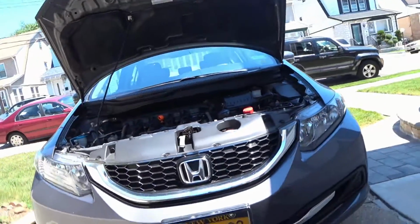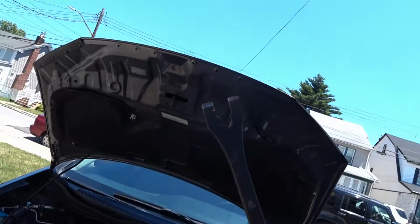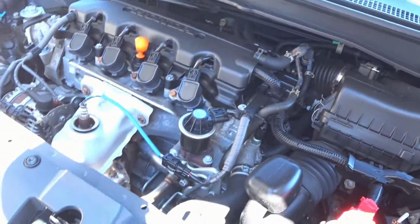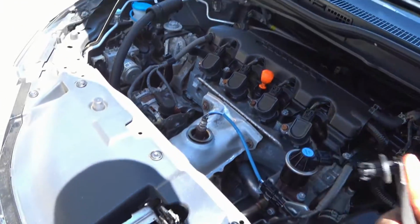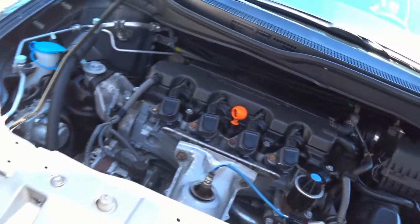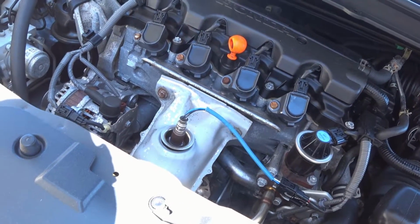In order to take out the pop-up pins, this is a special tool that you use. You can use a flathead screwdriver, but basically just go underneath it like that, wiggle it a little bit, pops right up. Makes taking these things out a lot faster than using a screwdriver and damaging the whole pin.